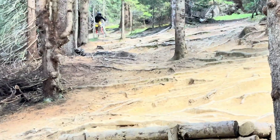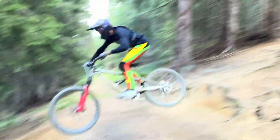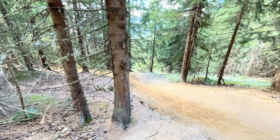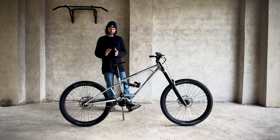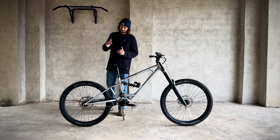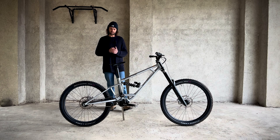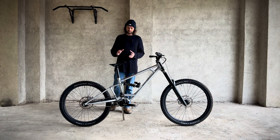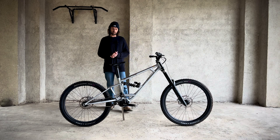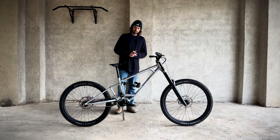Easier to brake — you can brake harder, which means you can brake less, which means you're not braking and hindering the suspension from moving so much. Also with steel construction, good damping suspension setup, and running quite soft spoke tensions, a lot of those factors can offset this harshness from the suspension. If you've got a really hard, stiff bike, you can feel that harshness more. But on this bike it really absorbs a lot of that in other ways. So under braking — excellent grip, excellent braking characteristics, really easy to brake hard and late into corners.